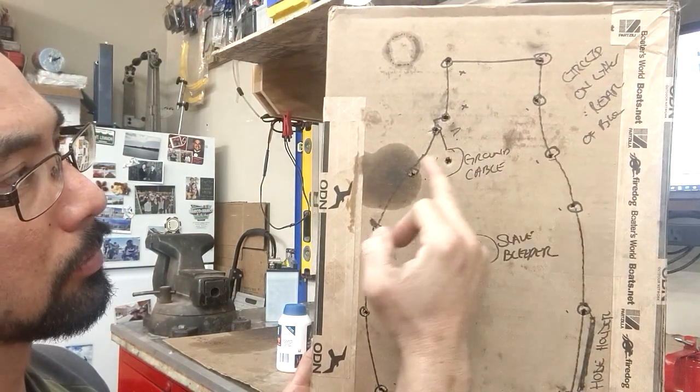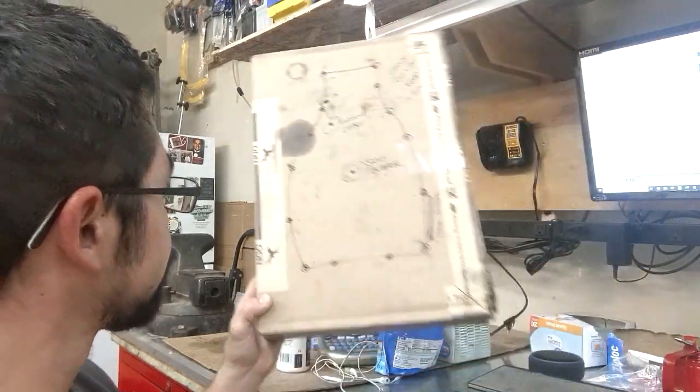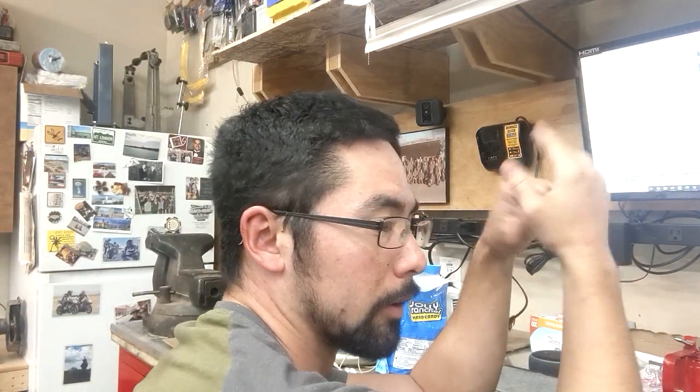On the other side of the box, I noted where the bolts go as a memory jogger for when I took the clutch cover off. These bolts up here are very difficult to get to. I have a relatively slender figure and I'm able to reach my arm up underneath the frame into that area. Be prepared to have pretty much every type of 10-millimeter tool, including offset wrenches, swivels, and quarter-inch drive stuff, to get those 10-millimeter bolts off — and putting them back on is a whole other story.